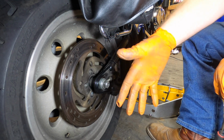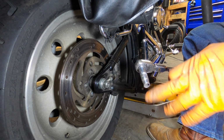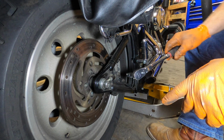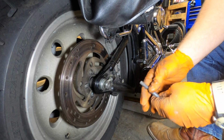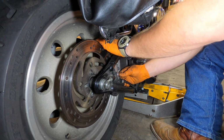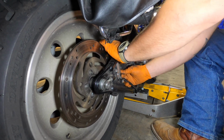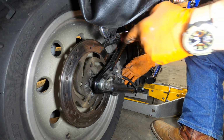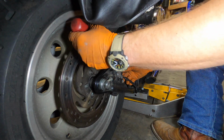But if you do have a long exhaust, you can get in here with a wrench. A 10mm 12 point. It has to be a 10mm, has to be a 12 point. You'll strip these out otherwise. There are two bolts. See if we can get it out. Take a prying tool and spread the pads open gingerly. Try to anyways.